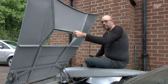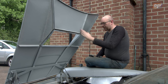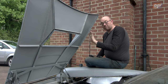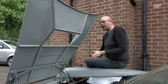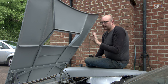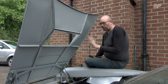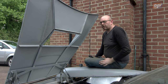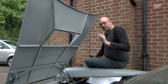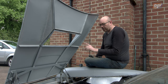On the underside of the bonnet, I've trimmed down all of these edges where the framework was, because this was cut-down box section to make L-channel so that we could get something that was both strong and light and not too overkill for the bonnet. So that's all been trimmed down, and we've filled the inside edge of the welds. We've cleaned up as much of the welds around the inside as we possibly can without going too thin, because we really don't want to break through the metal. There are a couple of pinholes left, but I've decided we're just going to seal them up with sealant around the inside. Most of the edges have been sealed and then painted over again so we can see where any ripples and dents are.